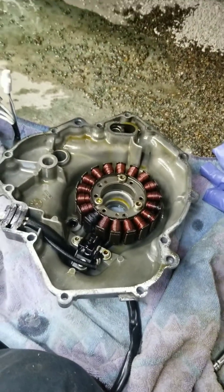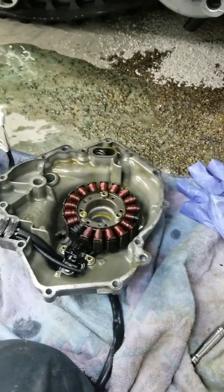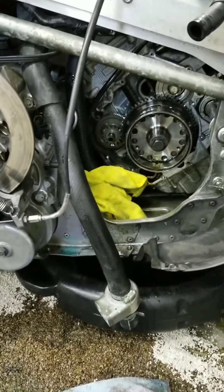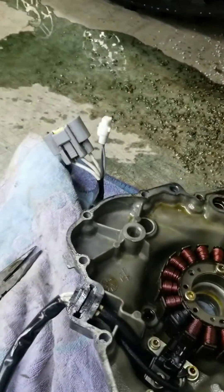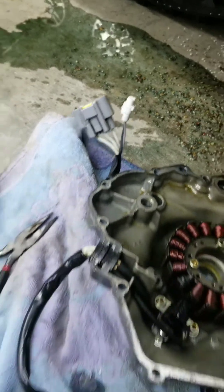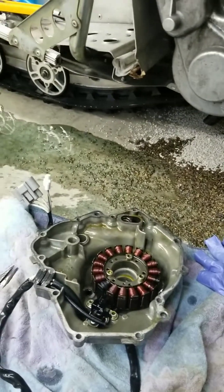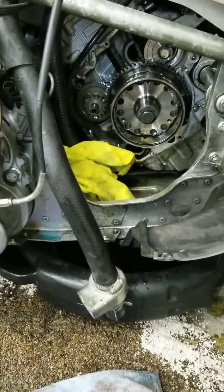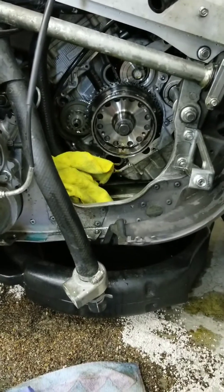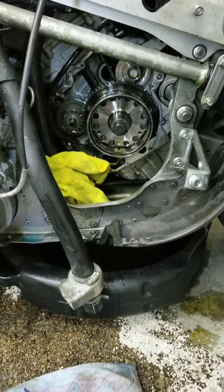This is my problem — I had minimal output on two of the three phases, so I'm quite confident this will solve it. Putting it back together is the reverse. The new stator I'm waiting for comes with the identical harness that you just feed through and plug back into your regulator. The regulators look complicated with those two big plugs but there's usually just three AC wires from the stator and a red and black for voltage — quite simple. I'll check back in to verify that this solved the problem, but I believe it did.